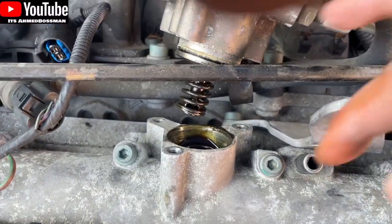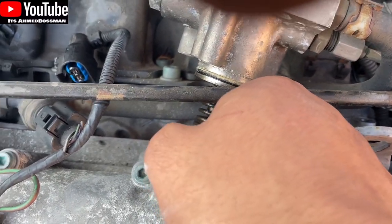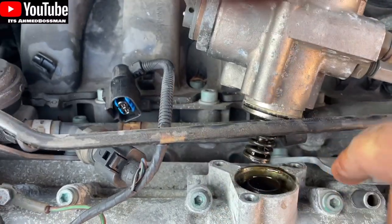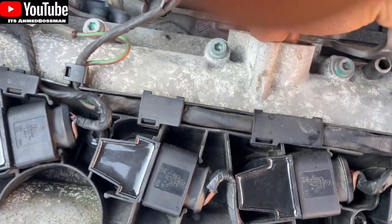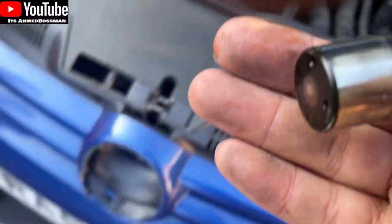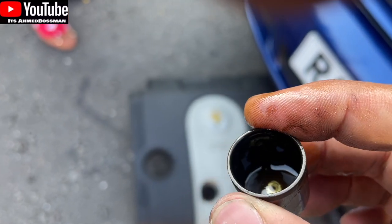So I've pulled it out, and now I'm going to put my finger in and pull out the cam follower. The cam follower is obviously this thing that I'm pulling out now. It's a bit fiddly to get out - you've got to do it a couple of times as it keeps slipping down. Obviously there's not much clearance there, which is as you'd expect in the engine.